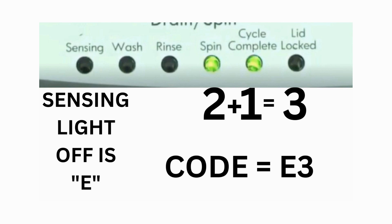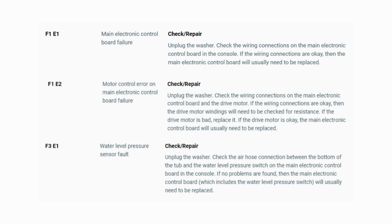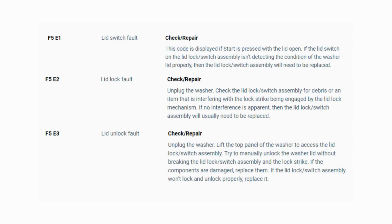That's one code. The same error code flashes repeatedly until you turn the dial 1 click clockwise to show the next error code. Turn the dial again and see if you have any other codes; if there are no more codes then you're done. To exit diagnostic mode, turn the washer off. Now you have your error code — use the images in this video to look up your error codes, look in your washer repair manual, or just Google 'top load washer error code' and enter the code, and it should come up no problem. Now you know the problem and what's causing your washer to not work.